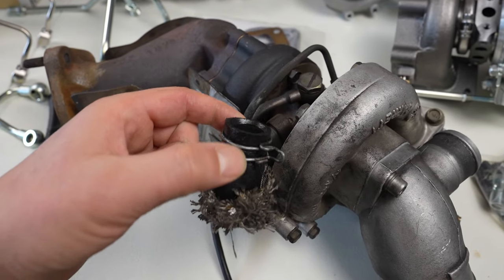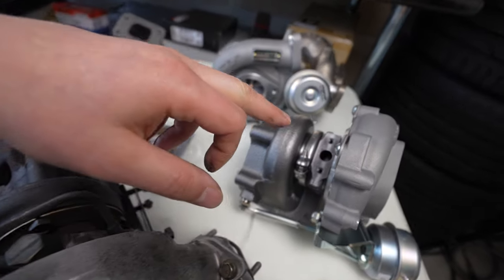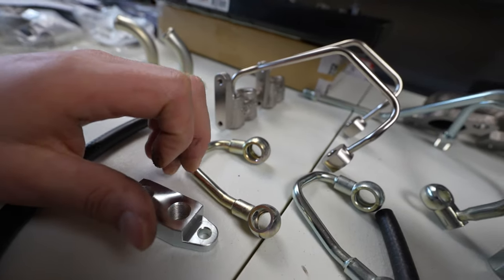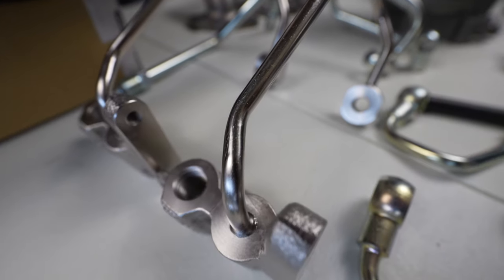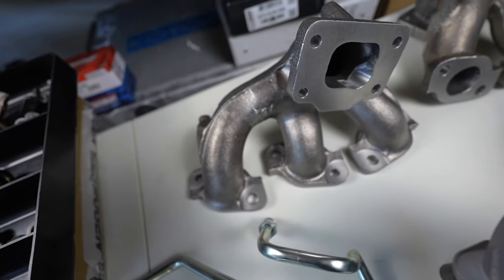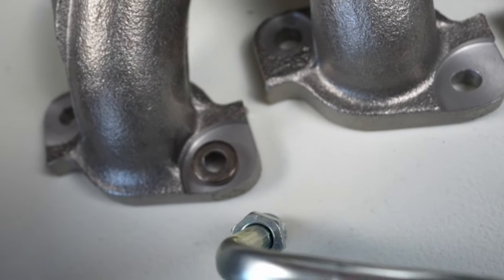You can see how hard these old turbo drains are — the new ones are going to be much nicer. The oil and water feed system is different on these; I'll go over all that in depth when I install them once I get the engine back from the machine shop. These brackets are a little different too. I love the machining on the OEM manifolds — you actually have a little room to slide them left to right when installed because the mounting holes are oval, giving you more play for installation.